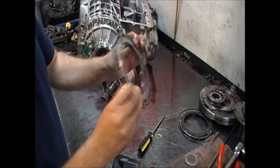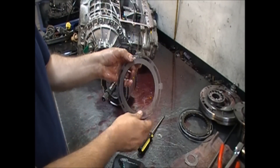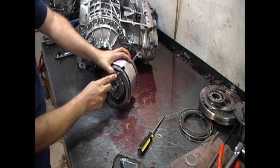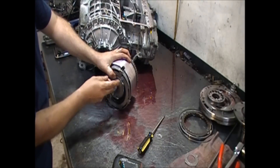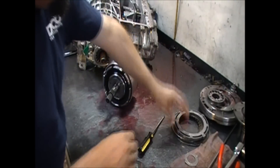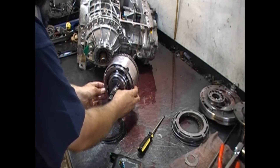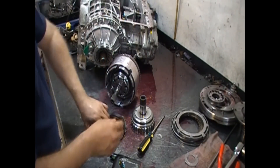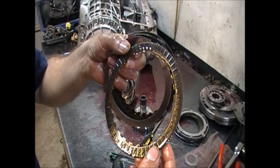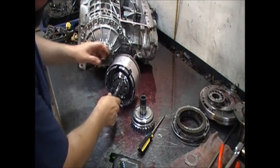This was installed in the proper position — there's a little step right here which goes to your overdrive frictions, and the flat side goes to your reverse frictions. If you're not sure and this is the first time you do this, whenever you get something out like this, always put a mark — an X, a letter, an arrow — so you'll know what position it came out in. Now we get the overdrive frictions out. These are brand new frictions, high energy — they are kind of greenish in color, like olive green. Those are brand new frictions.